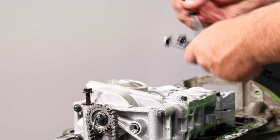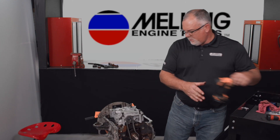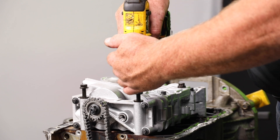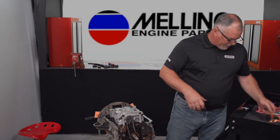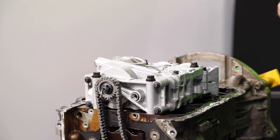We've got seven new mounting bolts — torque-yield bolts — so these must be replaced any time they're removed from the engine. Once we have those installed, go ahead and run them down snug and come back and take them down to the proper torque sequence.